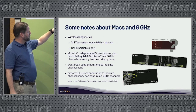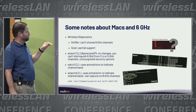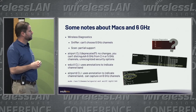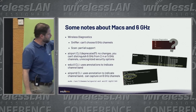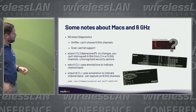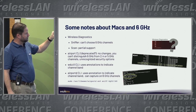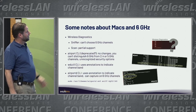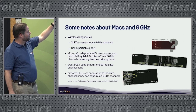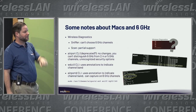We have WDUtil and AirPortD for getting some Wi-Fi information, and those tools have been updated — for example, when they print out the channel and width, there's an annotation indicating it's a 6GHz channel and such. Also, the wireless diagnostics sniffer used to not allow you to choose a 6GHz channel, so I need to check on the latest macOS version to see if that has changed.